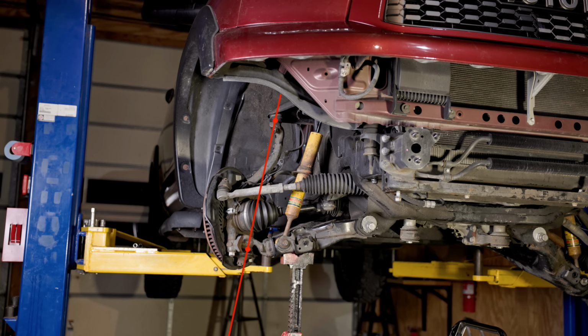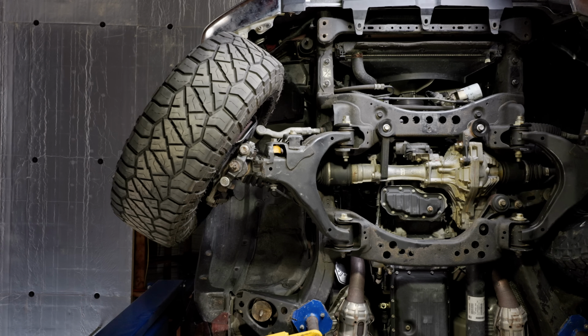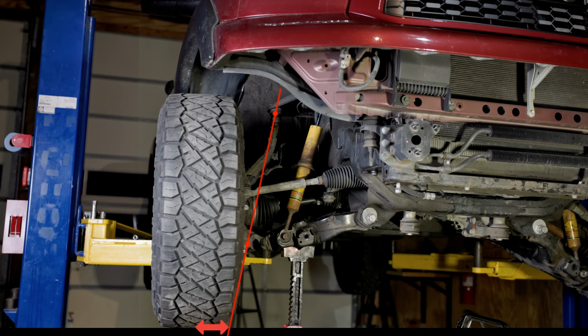The offset of the wheel has such a big impact, because the front wheel pivots about the steering axis. If the tire sticks out further from this axis, it will swing on the larger arc, which pushes the tire closer to the wheel well both front and rear. A lower wheel offset also increases the scrub radius, which has a negative impact on stress and handling.